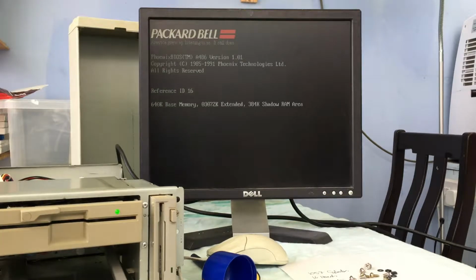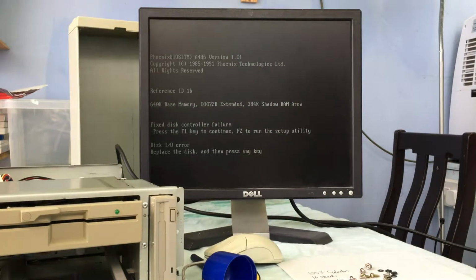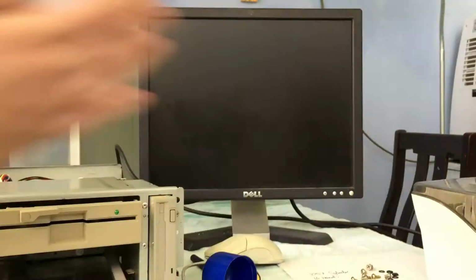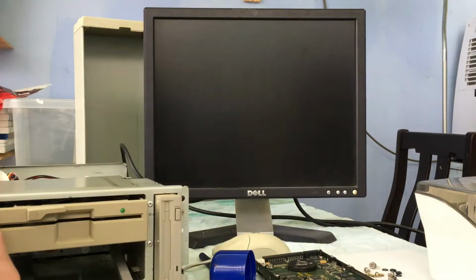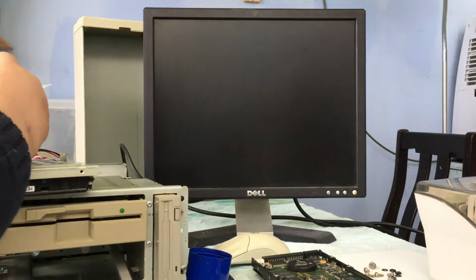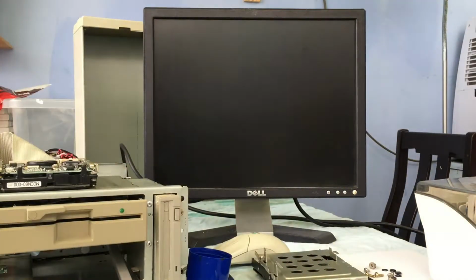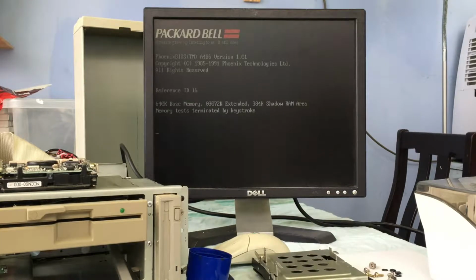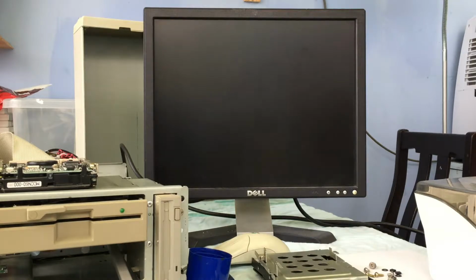The only thing I can think of, well, there's obviously a reason for everything, is that either this machine has a hardware problem, perhaps with the onboard IDE controller, which means that it's not able to detect and use drives above a certain capacity, so in this case it can't see or use drives above probably a 200 megabyte mark, or we have a problem with the BIOS itself.